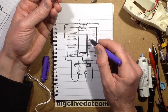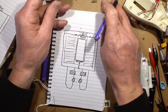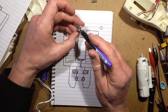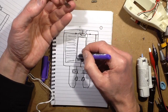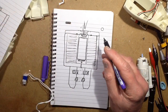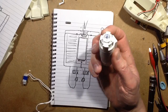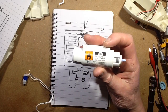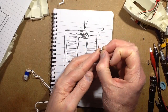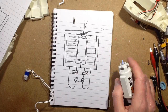This would even be called the armature — the metal outer case has a little release hole in the top plus a little black sealing ring. When you energise the coils it pulls the plunger up, releasing the gas, which flows up outside the plunger and out through a tiny hole in the middle, slightly recessed, basically flowing around the solenoid plunger and out the top as a spray. It's super simple — a lot simpler than I was expecting. I thought it was going to be more like a washing machine style water valve, but the butane propellant at room temperature isn't dramatically high pressure, so it doesn't take much to hold that little rubber plunger over the hole.